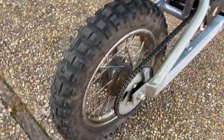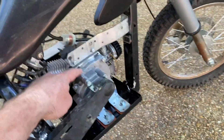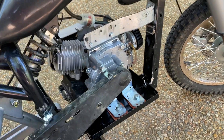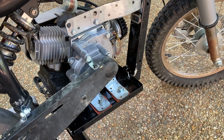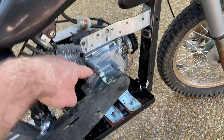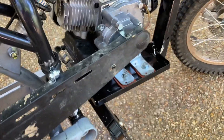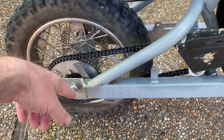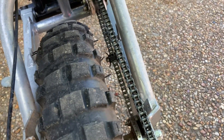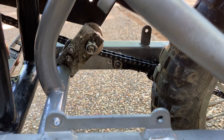I wanted to keep the chain on the side it was originally on, so I bought this gearbox that reverses the direction of the drive chain — the motor spins the same direction but the drive chain direction is reversed. It has a gear reduction system, I think four and a half turns to one. It came with a 20-tooth sprocket; we put an 11-tooth on it. This is a T8F chain with T8F sprockets, 54-tooth on the back. We used the original chain tensioner and also had to add this roller — you can see the little bracket I made for it — which is necessary to keep the chain from loosening up too much.